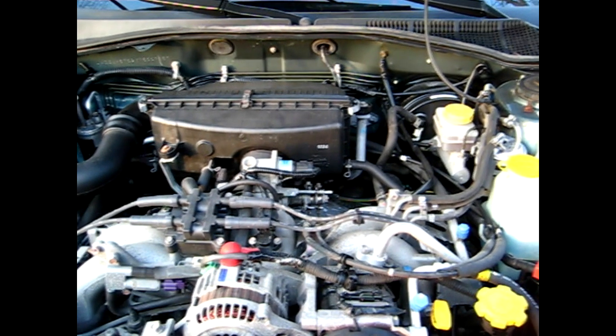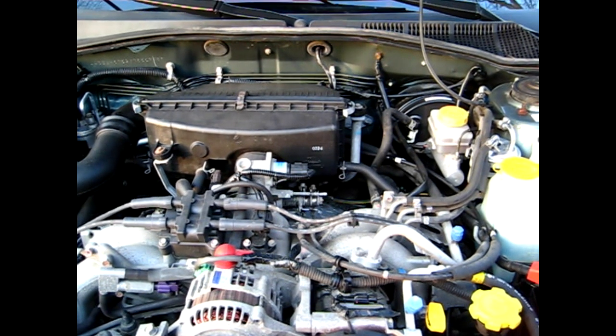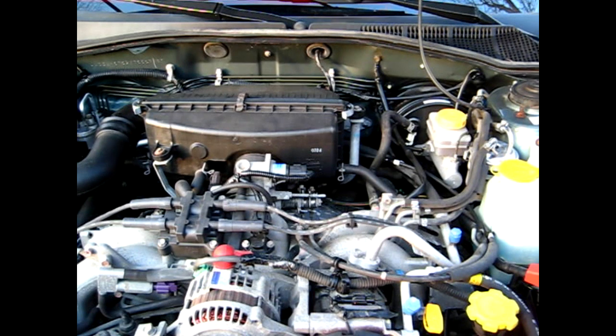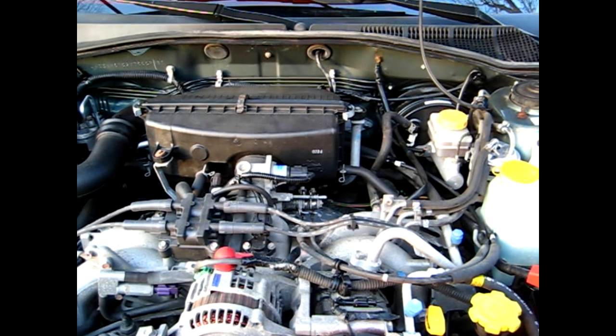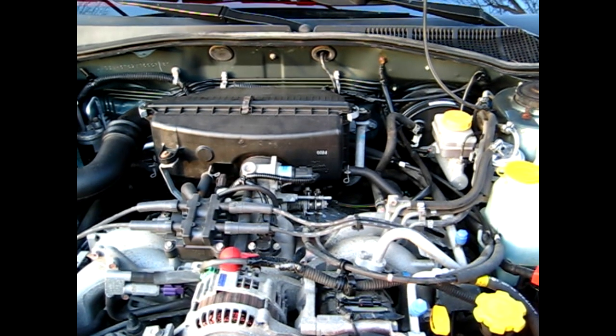Now that the engine's stalled, I'll let it soak for about five minutes just to soak into the carbon as I mentioned before. Unfortunately when I put the hose inside the fluid I figured it would have stalled out the engine, but the engine still kept running so I actually had to have someone turn the engine off for me.